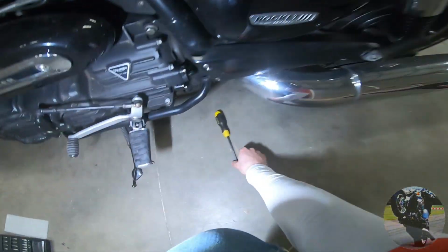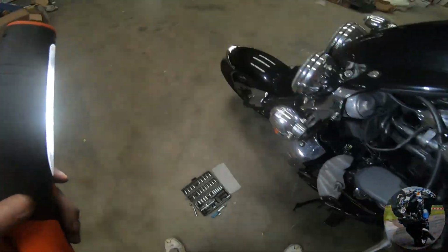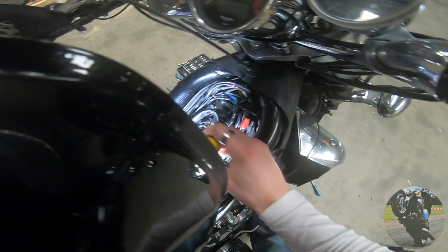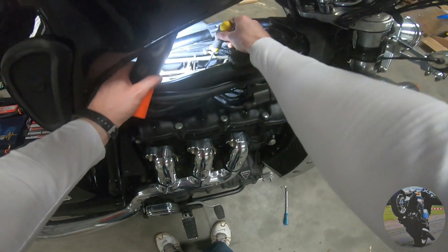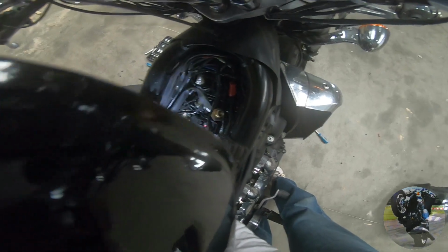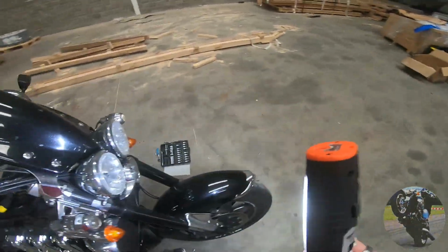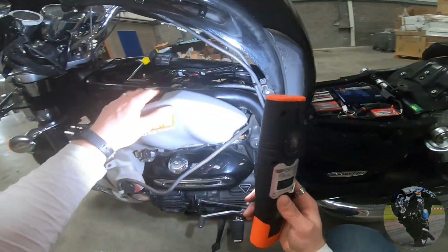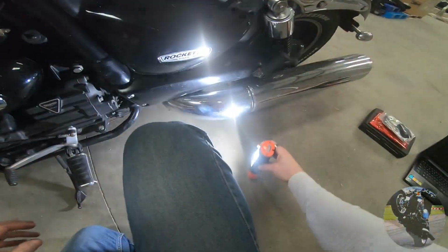So, what you need to do balancing your throttles is your screwdriver goes down onto, and do it from this side, goes down onto that guy there, and you adjust your, those two screws have to be adjusted, and this one here as well, for balancing your throttle. Now you don't have to take off this intake plenum here. It would just make life easier if you do, because you can see in here a bit better than see from that side. Just set this down for a second.